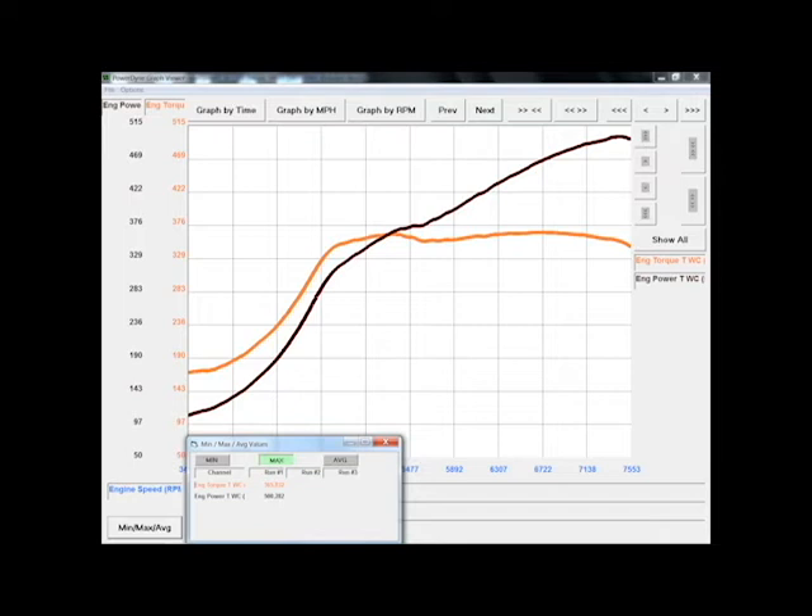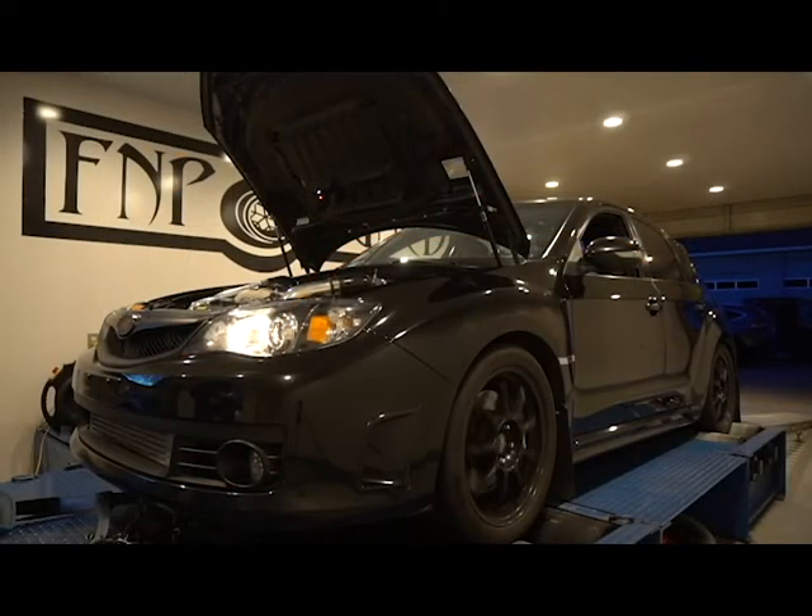You're probably wondering — we've talked about all the downsides to water methanol, why you have to run a failsafe, all the incurred expenses. What does it really get you? Amazing cooling, a lot higher potential for horsepower, and with the failsafe it is a very safe and simple system to run.